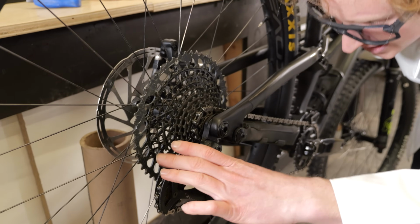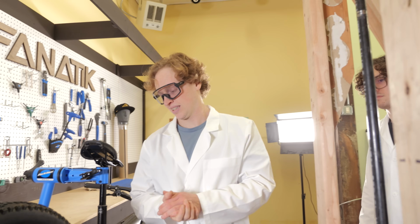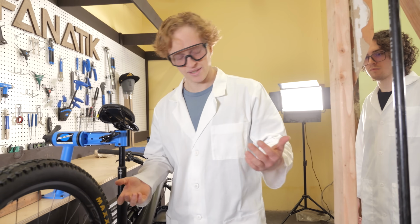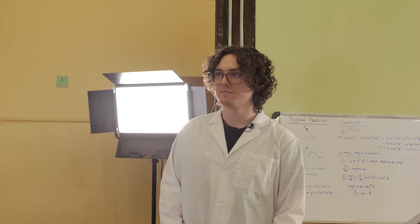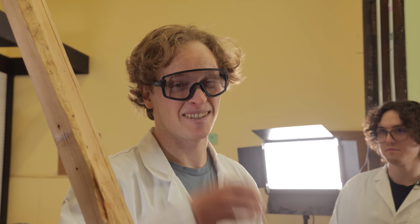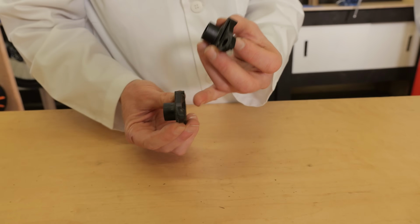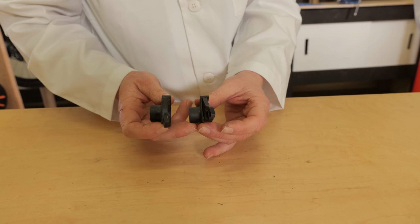Something is bent there and it will never be the same. So it looks like that's what it took: hitting it from the side with 32.5 pounds of force at about 9 miles per hour, coming in directly perpendicular to the derailleur itself, and it totally smashed the hanger. This was the first hanger we broke here. You can see it's fairly bent.